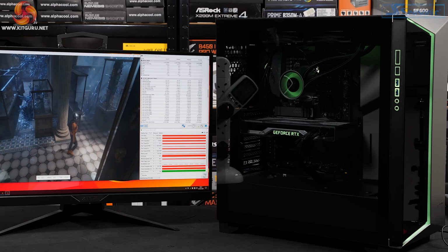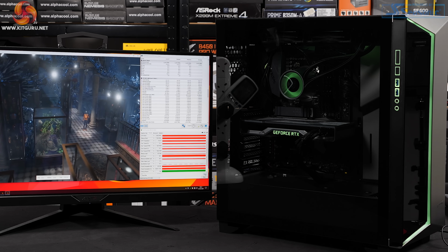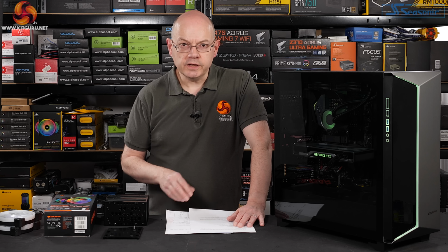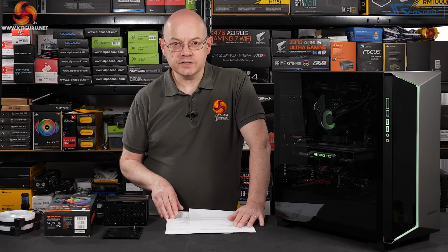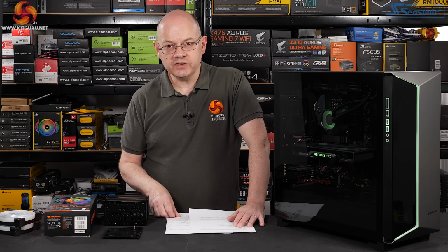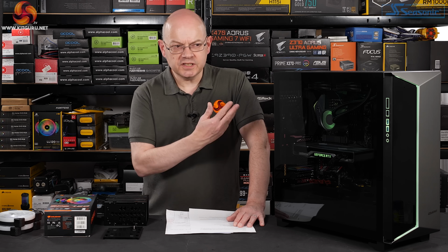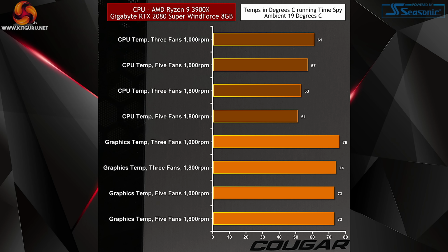That's not particularly hard on the CPU, and as a result, the power draw at the wall socket is 345 watts for this particular system. The harder test for the system is AIDA64, that really hammers the CPU and drives the power draw up to 415 watts. At idle, this system draws something like 80 watts at the wall socket. I'd classify the Time Spy test as moderate, whereas the AIDA64 test is harsh and fairly unreasonable.